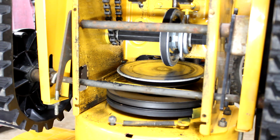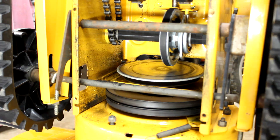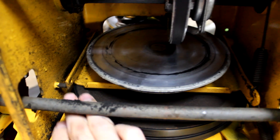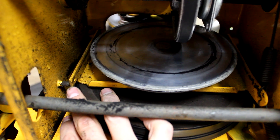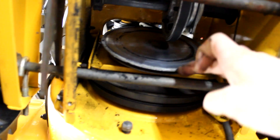We're going to go back to the back of the unit. The next step is you want to unhook the idler spring — it just pulls and unhooks. Now we have to back out the stop bolt, which is this bolt right there. The whole point of that is to allow this to drop down, and now it's resting on this wheel. On inspection, our auger belts are pretty good — we really only need to replace the drive belt, which is here, and the friction wheel.